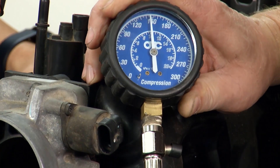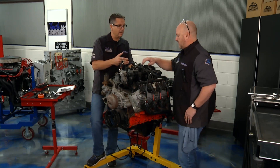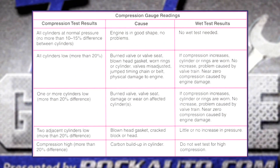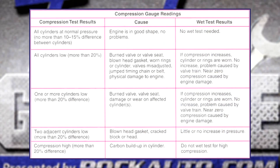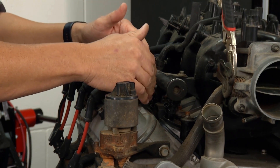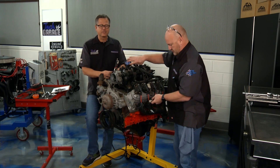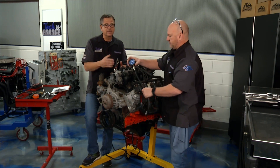We're just under 150 — pretty solid right there. The key is to go to the next cylinder and move on. Looking at this graphic on compression: if they're all close to each other and high, you're in good shape. If they're all low, that could be a timing issue or valve problems affecting all cylinders. If one or more is low, we're isolating that cylinder — maybe a valve, maybe rings. If it's low, you can do a wet compression test: put some oil in there, run it again. If it comes up, you've got a ring problem.